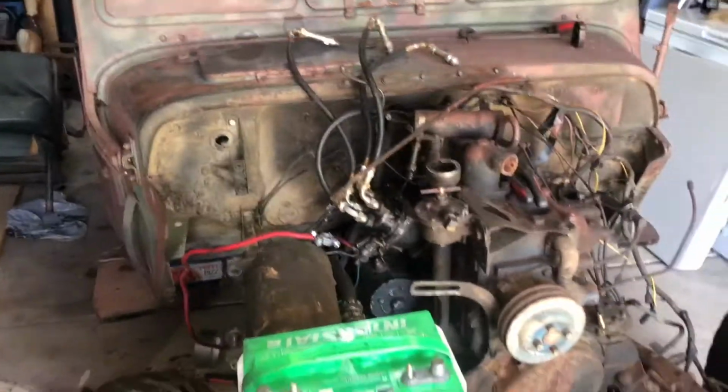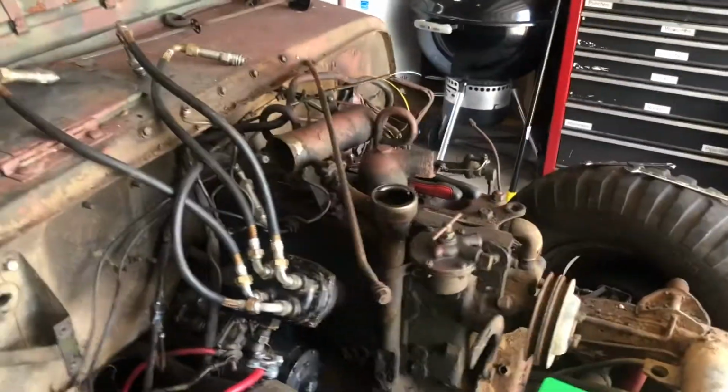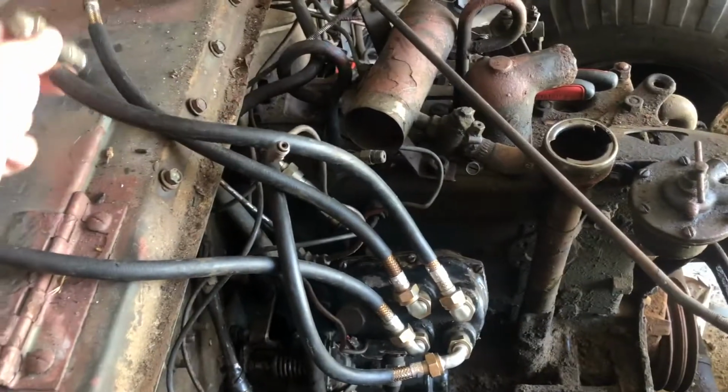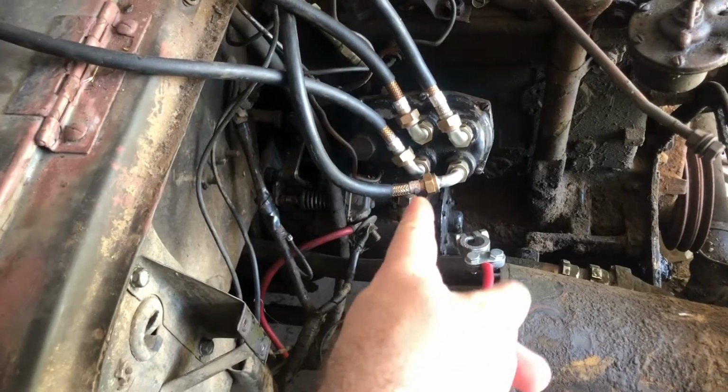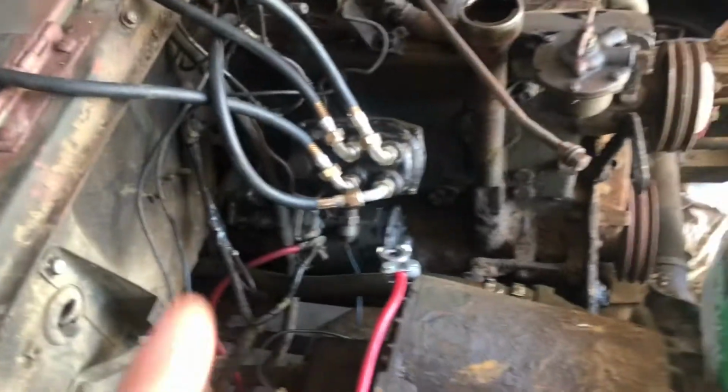Okay, so it's been a few days since I've been out here. I want to give you guys another update for this part 2 of the video. Engine is cranking. We do have fuel pressure. I did have to mess with the wiring a little bit, because after I cleaned up this distributor and put the new wires and everything on there, I was not getting any spark. Come to find out, 2 reasons.